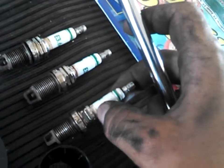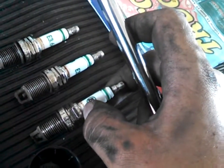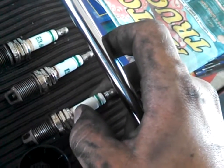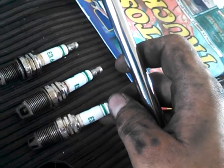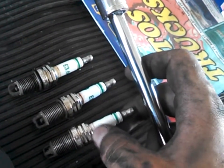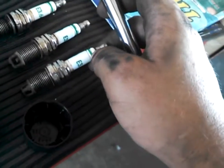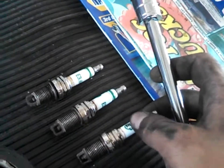because mine is a valve cover leak in there. So what it ended up doing is it hits this porcelain here. You can see that oil line where it's been boiling on it. That boiling oil will end up hitting this porcelain, and then you'll get an arc in between this electrode, and it'll actually short out and cause a misfire. If you're going to reuse your plugs and clean them up and reuse them, you always want to check that porcelain.